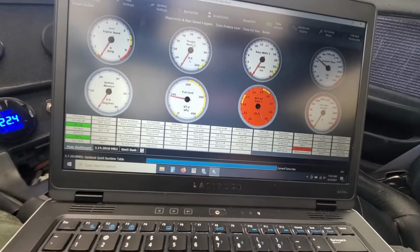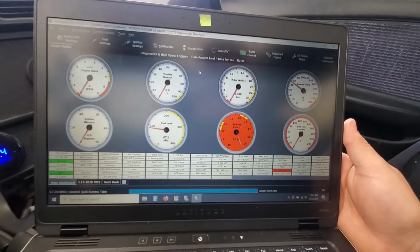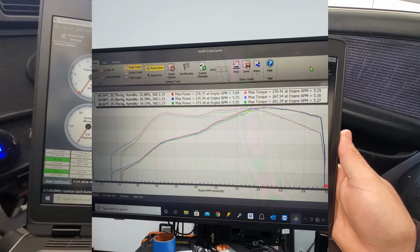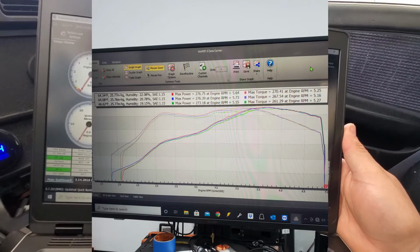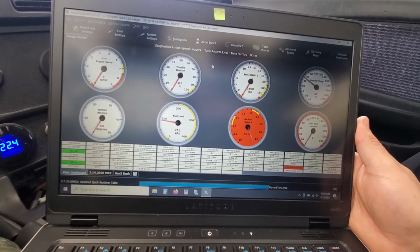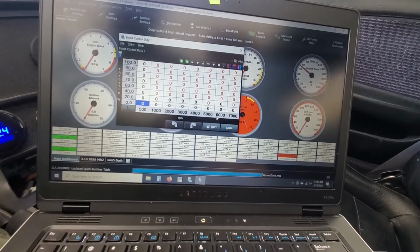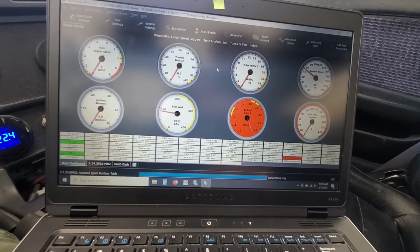Next thing, so on the dyno, let's see, I did 5 runs, I recorded 3 on the dyno, and out of those 3, I got 276 horsepower and 270 foot-pounds of torque. Not bad for this little MR2 and a stock Gen 5 3S-GTE. And that was with running absolutely zero duty on the wastegate, or on the boost control solenoid.